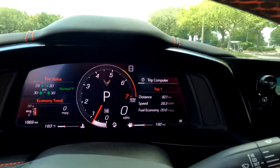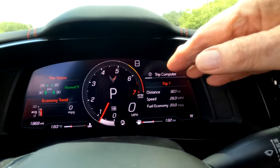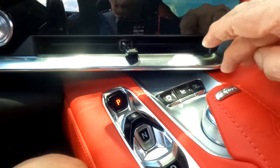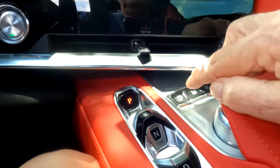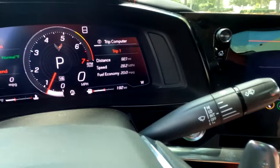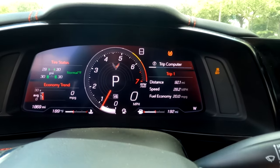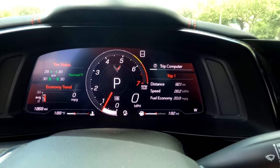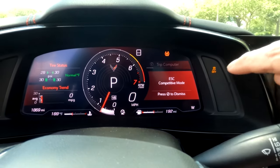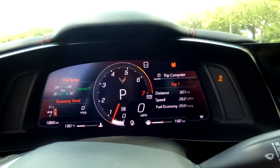With the car running, we're going to look for those two lights on the dash on the right-hand side. We're going to go to this button here — you see these three buttons and a dial to select different modes. The button on the left has a little car with a squiggly line that looks like it's laying a patch, and it says 'off.' We're going to push that twice. Watch the dash: once, twice — and there they are, one and two. We're in performance competitive mode. Now you've got to put it in drive.